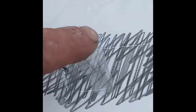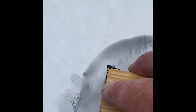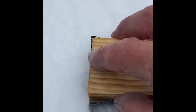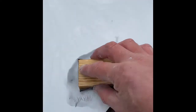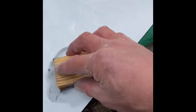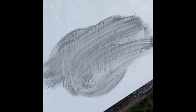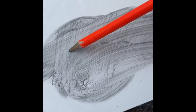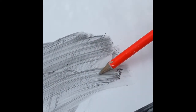There's still a very faint line, and this is where the pencil trick really comes into its own - you can see how the pencil shows up the line around the outside. We're really getting there now; we can barely see the repair and barely feel it. With the pencil we can still just see a really faint line all the way around the edge, but it's pretty good across the middle and the sides.